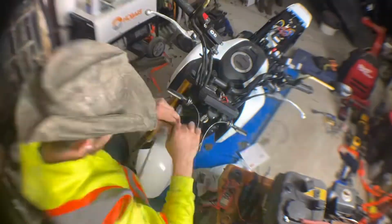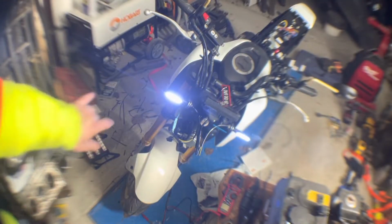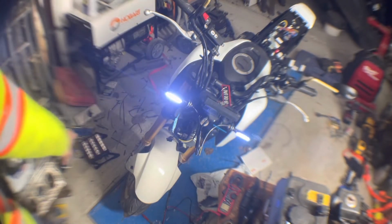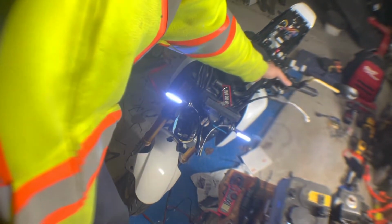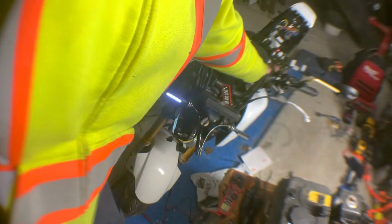And these lights have switchbacks built in, so there'll be the low beam headlights and the turn signals. And just like that, guys, I now have running lights, even though these are my headlights, low beam, and then I'm gonna tie in the headlight there in another video to the high beam. So this is low beam, even though these are running lights, and they're quite bright actually. And with the new relay, and I removed the old resistors, now everything works. So very happy about that.